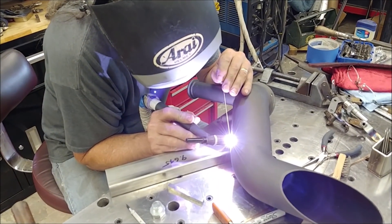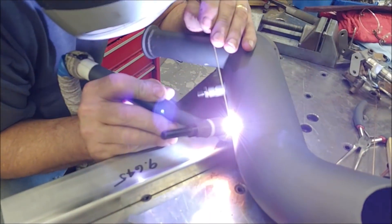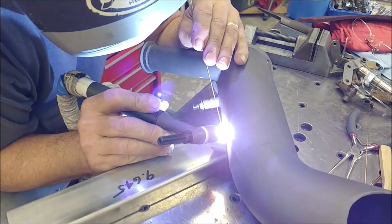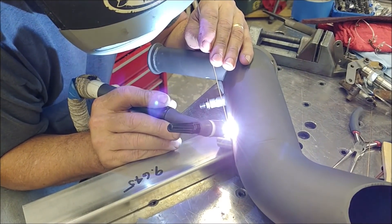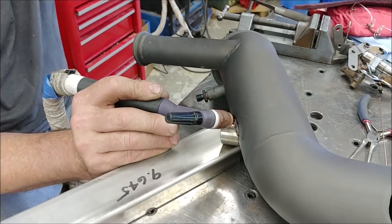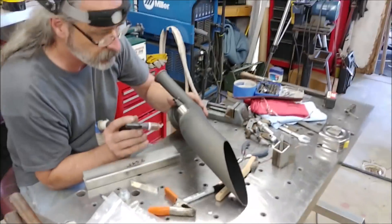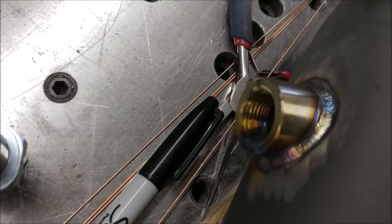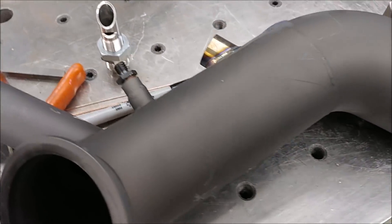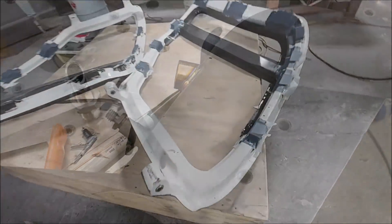Here Brit's welding on that little extension to the exhaust, so hopefully that'll solve all the problems with what comes out of the crankcase. I wasn't really happy about having the oil collecting in that breather, and there were all kinds of gases still coming out that had to go somewhere with probably still a little bit of oil. This is the right solution for our application. Just have to create the hose now to connect the two things.